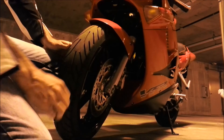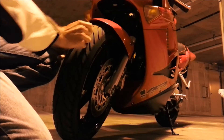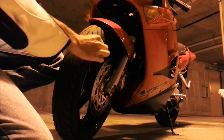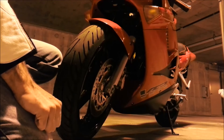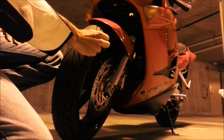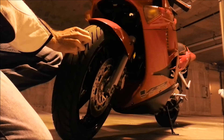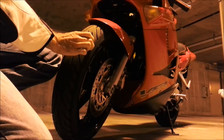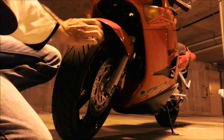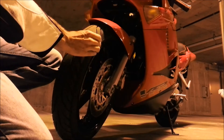This tread pattern is a dual compound tread pattern. You've got basically a firmer compound in the center, and then on 25% of the sides, you've got basically a 2CT — which was the Pilot Pure, or the Michelin Pure rather — tire compound from the previous year's model. So you've got a more aggressive, stickier tire compound on the side, and then a firmer compound in the center. There's also some underlayering on some of these models, like the Michelin Road 3, and some of the other tires — they have a double layer underneath for firmer posture on the sides, and then a layer on top which is actually the grip layer.